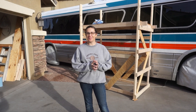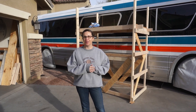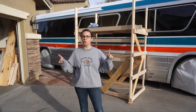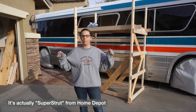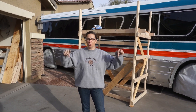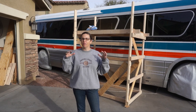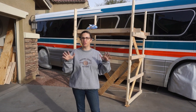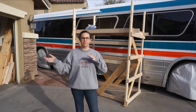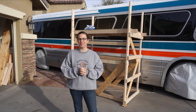Good morning! We are finally ready to start putting the solar rack up. Our friends Jonathan and Ashley from Tiny Shiny Home and their family are going to come spend the day with us and help us work on this project. Our first step is going to be to put the unistrut up on the roof, using the upper racks to make sure they're spaced and centered properly, and then we'll drill holes through the roof and bolt that unistrut through. We'll put some sealant on all of that when we're done. Goal for today is to get that unistrut installed.